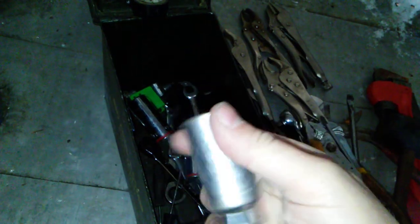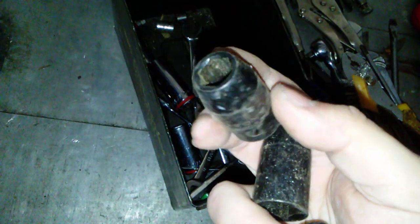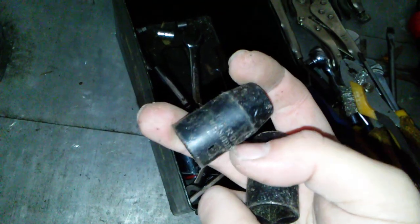Extra sockets in the sizes you need — these are Duralast: a 22, a 23, a 20, and an old spark plug socket I use to remove universal joint caps. You put it down in there and hit it — that's what the big hammer is for. O-ring picks, a pipe cutter, hardened larger-diameter sockets for rusted brake components, a flat punch for beating one end while the other end is flat, and extensions — you can never have too many.